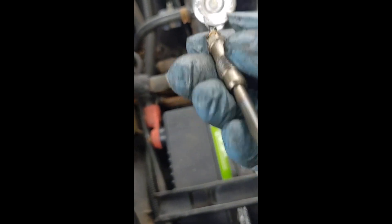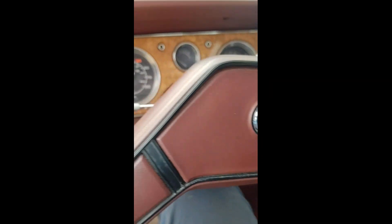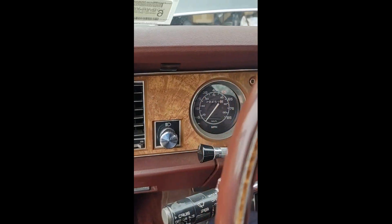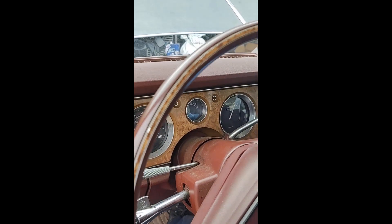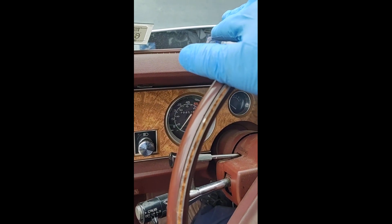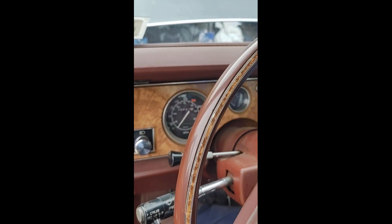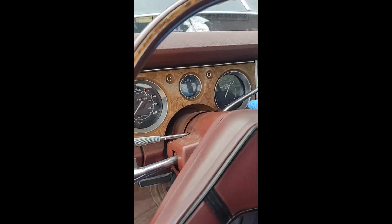What I did before: I did four injectors on this side and four glow plugs, then started it up. It wasn't easy to start but it did start just by turning the key and it was running on four cylinders. My advice is to run it on four while the other four bleed out - if you do all eight at once you're going to have a hard time starting it. Now the four are bled on this side and the other side might go a lot easier.